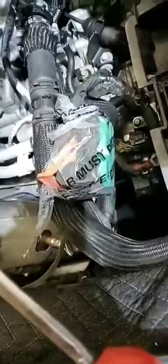After you're all done you're gonna have a lot of cooling residue everywhere. I like to cover up my PCM connector — you don't want water interference inside the connector. Throw a little bit of water on the area where you're working to get all that coolant out of there.